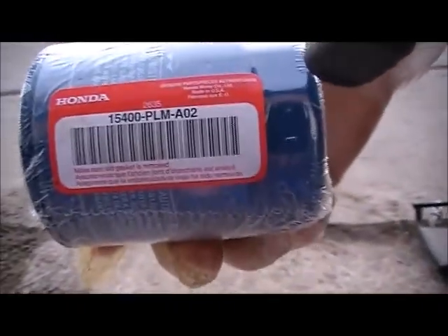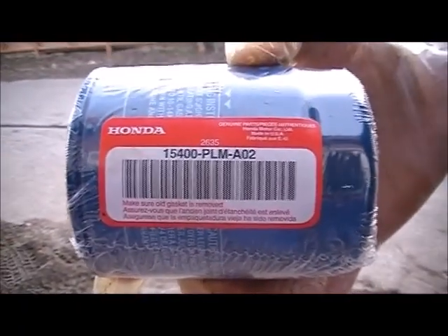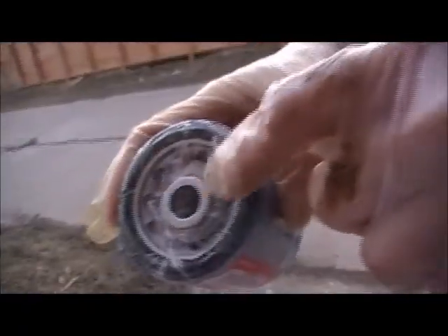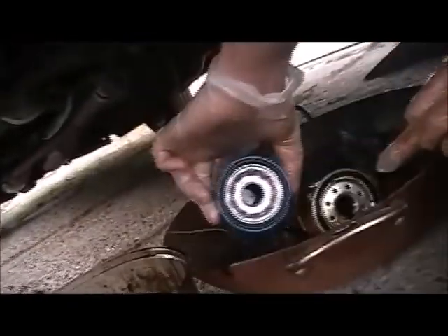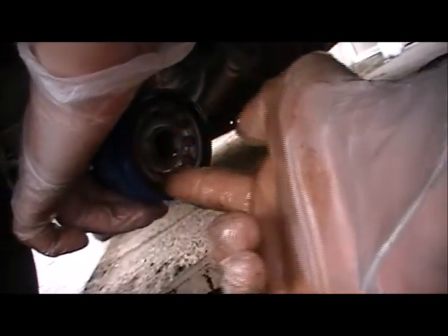I'm using a Honda oil filter — there is the part number. Ensure you get the one that has the crush washer for the bolt. The previous owner had a Ford filter, and you can see the holes were smaller, and also the Honda one had an oval o-ring while the Ford had a flat o-ring. Here I'm just placing some oil on the rubber so it doesn't get caught and it's easy to install.